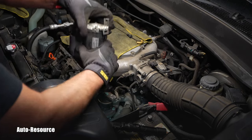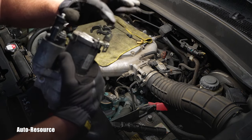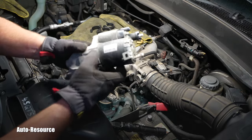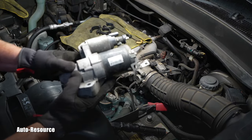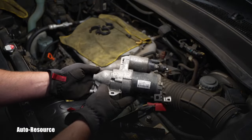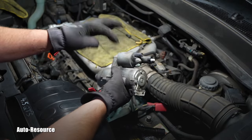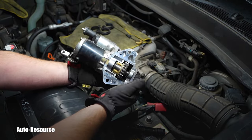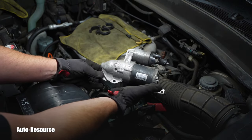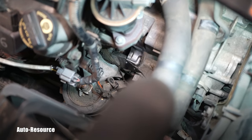You have to be careful about those sharp edges. One of the hoses got caught immediately. And guess what — as we expected, this is the original Honda starter; it was never replaced. The problem is most likely in that solenoid — it aged and it's just time to get a new one.